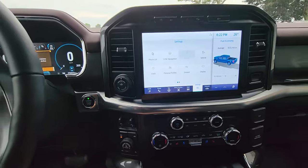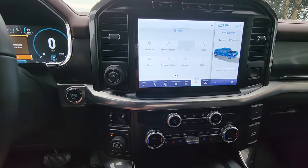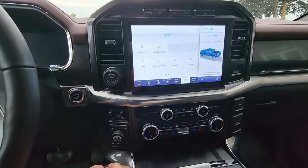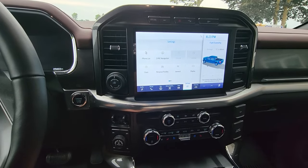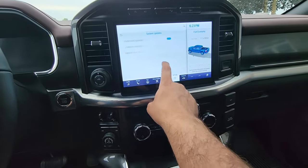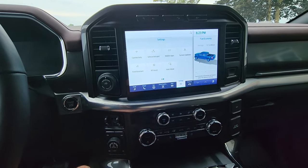Once you've shut your Wi-Fi off, turn your parking brake on. Make sure your truck is off, exit the vehicle, lock it, and walk away. It could take up to 24 to 36 hours before you start seeing an update come in. If after 36 hours you don't get an update, repeat the exact same process: reboot the screen twice, do all that stuff inside Settings while connected to Wi-Fi, send those two 'Wireless Update Not Working' reports, go to System Updates, schedule the update for about two hours from now, click Update Details, shut your Wi-Fi off, and off you go.